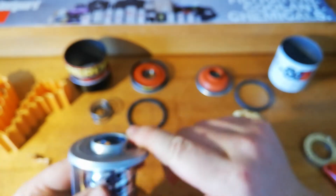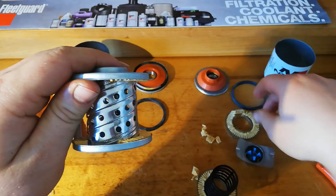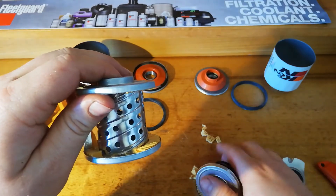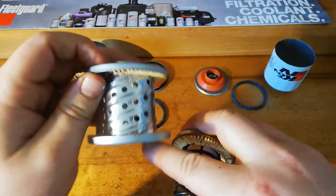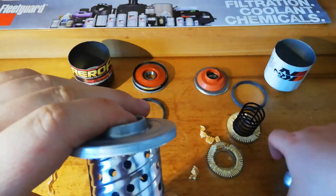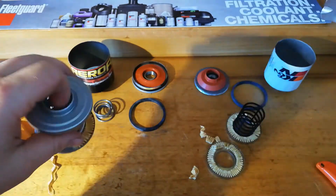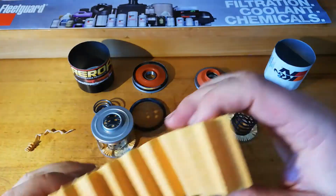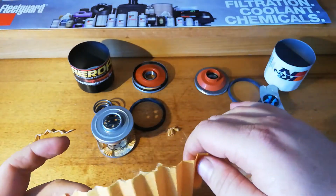The glue is a bit disappointing, but in terms of the construction of the center tube, it's quite nice - a lot nicer than the K&N with the dodgy plastic and thin metal caps. The Aeroflow has got good oil flow through the holes, even though it's not louvered like it says on the box. The K&N has our dodgy leaf spring as well. But we'll have a look at this media under the microscope and see what we're looking at.